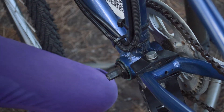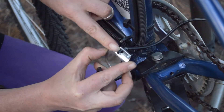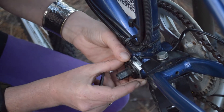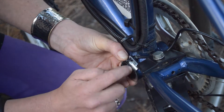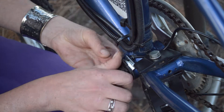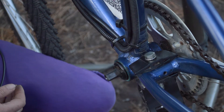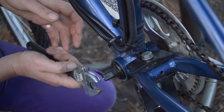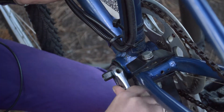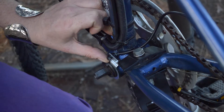So now it's time to fit our sensor. The cable is going to go towards the inside with the sensor component facing towards where the magnetic disc is going to be. Now something to notice here is once we put that in place, we have very little thread left for this lock ring to actually tighten up — whether it will even grab on that amount of thread, not really. So what we want to do is actually wind that thread out a little bit this way. This is where the handy little shifter comes in. There is probably a specific tool for this, but we can do it just like so. Now we can put the sensor on and we've got more thread to add the lock ring.